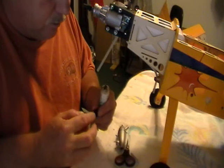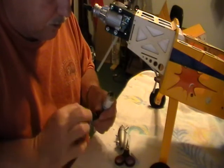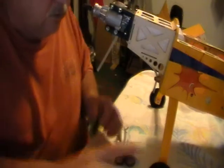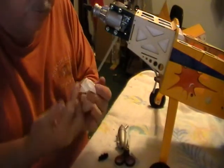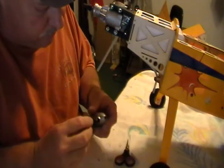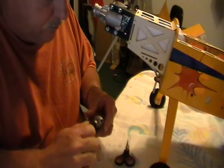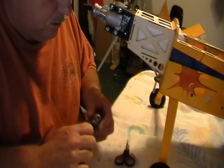So you want to put a thin coat of this heat gasket. Make sure it's for heat, for engine, automotive or something, for a car. So not just silicone or something. Now, got it on that side. We'll thread that into the muffler down to about right there.